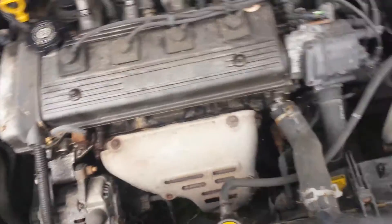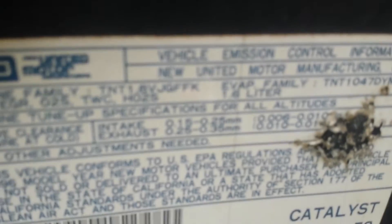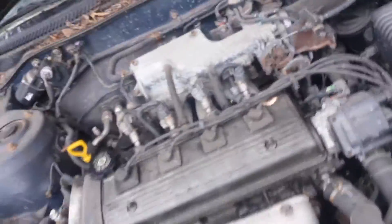Race mode enabled. Does she have a horn? Of course not, it's dead. I'm kind of disappointed because this is actually a 1.6 and not a 1.8. It looks almost identical to my 1.8, but my other one is a 1.8 automatic. It also came with carb cleaner — that's what I use to start it, because the gas tank strap is flopped over like a dead hooker and she probably unplugged the fuel pump. The relay clicks with the EFI but EFI won't work without the fuel pump.